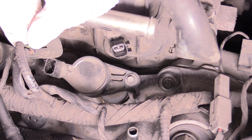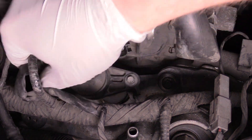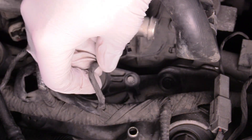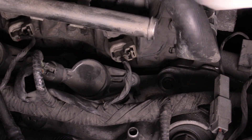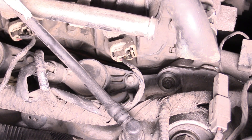And then we can plug our electrical connector back in. Usually it makes a nice little click, but just make sure it can't come off. And then I'm going to hook my fuel injector back up — but you did not need to unplug that. I just did that for filming purposes because you can see that this tube goes right over our ignition coil. So that is how you check for spark on an automobile that is cranking and not starting. The first thing we always go to is straight to the ignition coil to see if we're getting spark, and if we are getting spark we can move on.